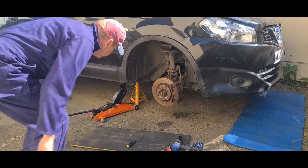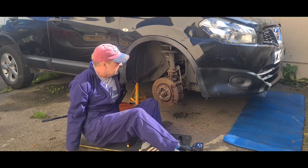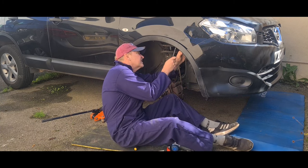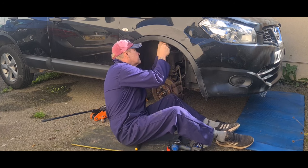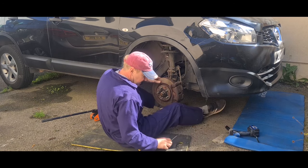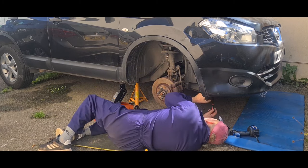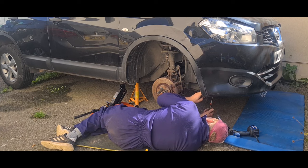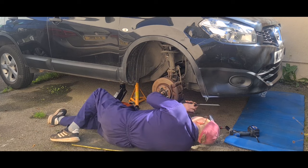What I'm most concentrating on now is getting this arch liner out, because we've got to get the wing off and I imagine all the bolts, as per usual, are going to be behind the arch liner. Time to get down and dirty. Okay, nothing too dramatic — one missing up here, looks like that's broken. There's a little clip up here. These are brilliant little tools — I suggest you get one if you're going to be doing work like this, because it makes popping these clips out so much easier. We're trying to find out what's going on here together because I couldn't find much in the way of instructions.